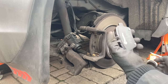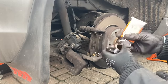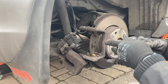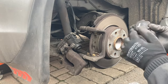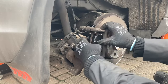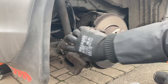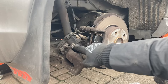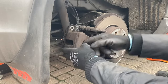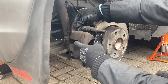Now just as a failsafe, these little notches that the brake pads will be sliding up — we can also line them with a little bit of copper grease, pushing it around. As you can see I've fitted the front and rear brake pads — just want to squeeze them in and make sure they're seated well. Now we have to fit our caliper over this, and if your caliper does not fit over you'll need a piston rewind tool to push the piston back. But using the Mercedes system, it's already pushed back for us so we can easily just slide this on.